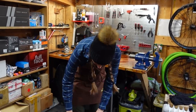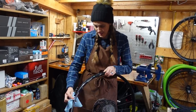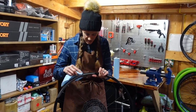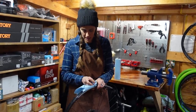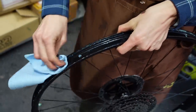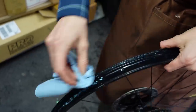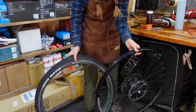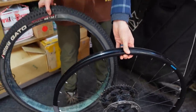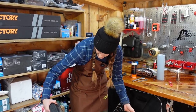We hosed off the wheel and we're going to give it a good wipe down. This is easier and more fun for everyone if your wheel is clean and dry — same goes for your tire. If you're using a used tire, try to get as much of that sealant crud out, especially around the bead. Just check the rim tape looks good. Cleaning gives you a better idea of how your rim tape is looking, so if you need to replace it you can do so now instead of fixing your flat and then having it go flat again. You want to get your tire and wheel as dry as possible; if possible, leave them overnight.